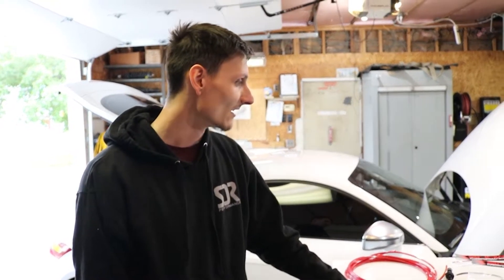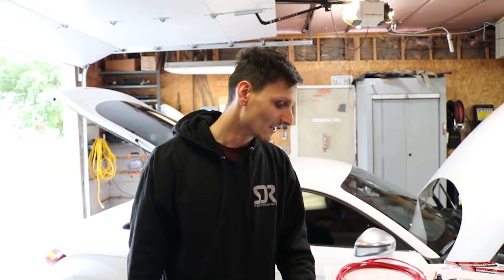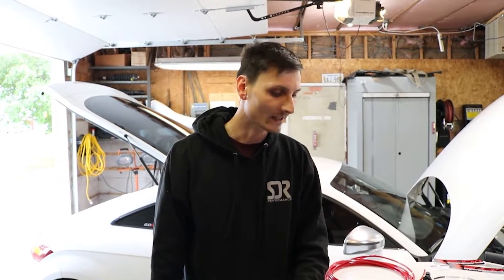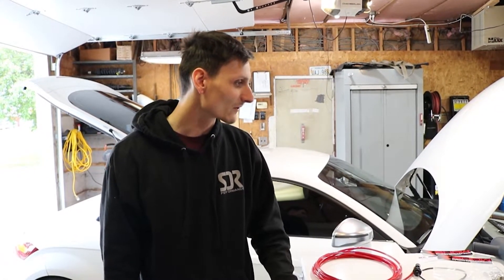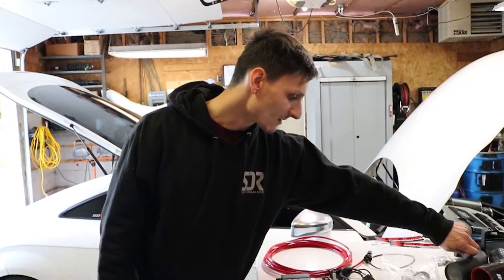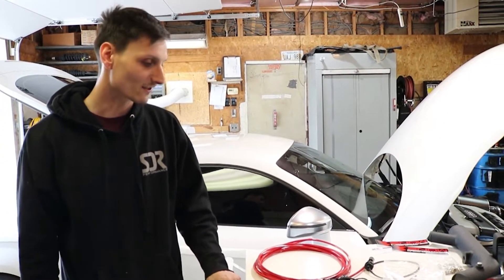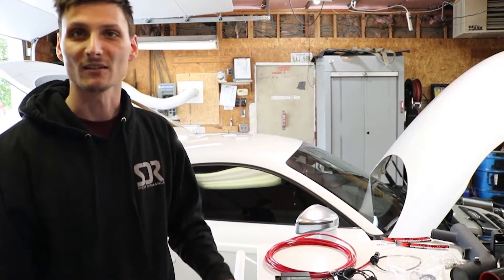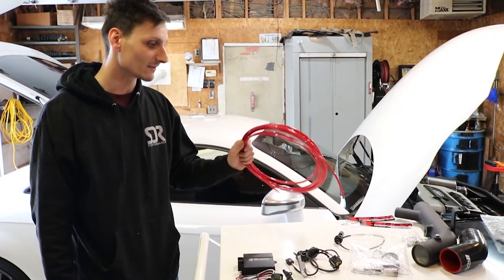Welcome back to the channel. We're going to continue modifying the Audi, going further into the Stage 3 area — we're going to put a water methanol injection kit on it today, really trying to boost the octane level of the fuel. In our area we don't have the greatest fuels, and I've been noticing some pinging lately, especially moving into the summer months when they change over the fuel. Hopefully this helps — water methanol is always a good idea when you're modified well above stock level, because it lowers intake temperatures, increases octane protection, and kills spark knock.